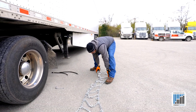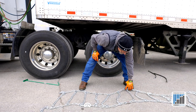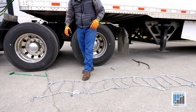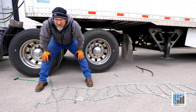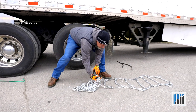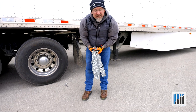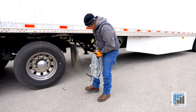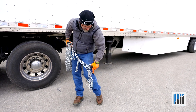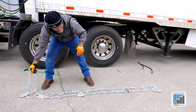After you've got them taken apart, I'm going to fold the chain back up and throw it in the side box. Take an extra bit and lay it back out. The big reason for laying it back out: one, it's going to keep it from being twisted; two, you can check for damage. That way if you need to get a new chain or get one repaired before the next time you use it, you'll have it done. Now picking them up and putting them away — there's really a right way and a wrong way. The right way: start on the side with the spare links, pick one, skip one — pick up every other cross link. Once they're picked up, they're in a bundle. If you've got a chain hanger, none of them are going to hit the ground. If you're going to put them in the side box, wrap them up with a bungee cord. When you go to lay them back out next time, start on the side with your hooks and it'll just lay right back out again. It won't be twisted, it'll be ready to go.